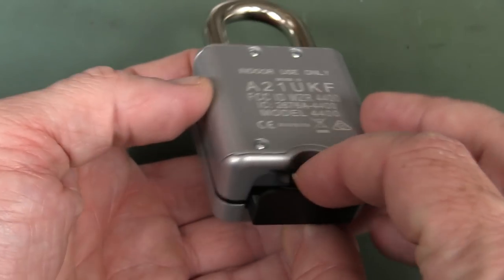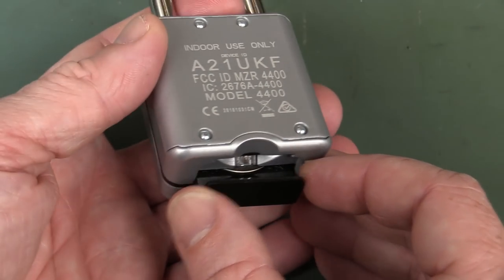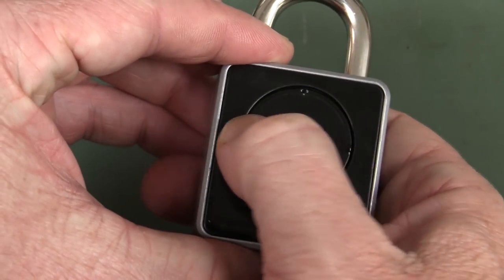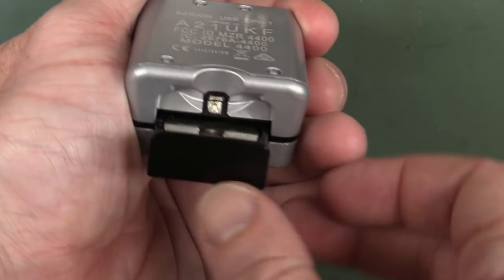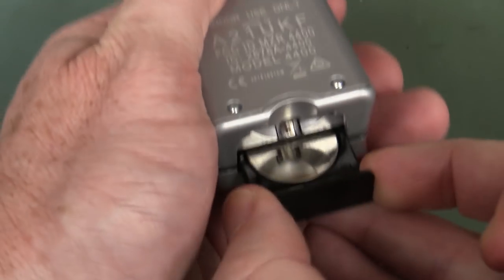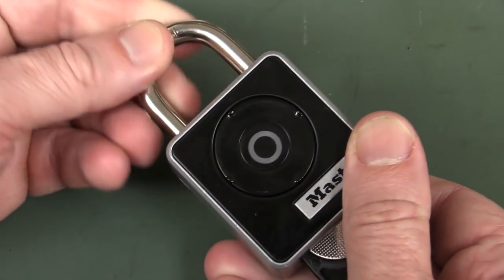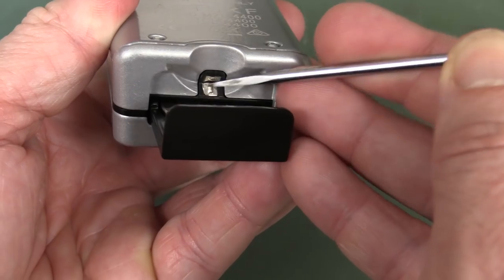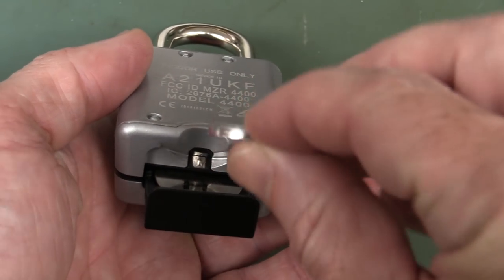What I like is the design of the battery compartment. It uses a CR2450 battery, but it doesn't let you pull it out when it's locked — which is great, so little smart-ass kids can't come along and take out the battery. So if I open that and enter the combination, the battery compartment opens and we can pop out the CR2450. But it's actually got a backup — you can see the contacts in there so that if you've got a flat battery and it's locked, you can apply an external battery via those contacts.